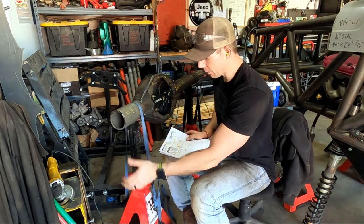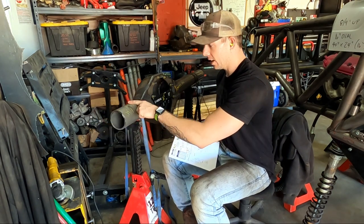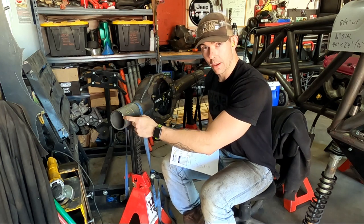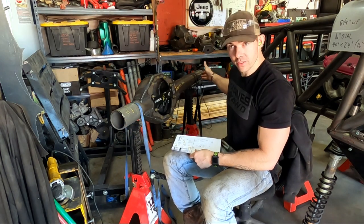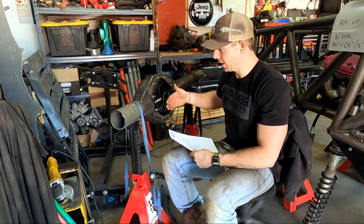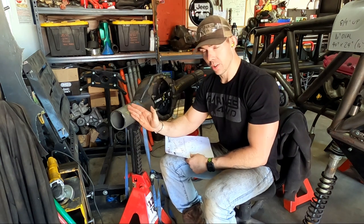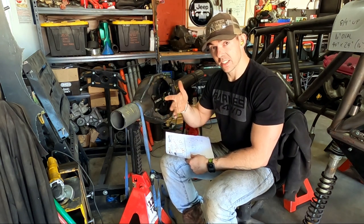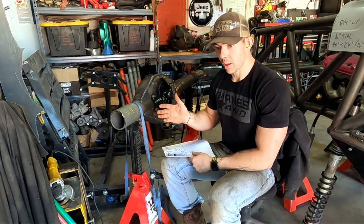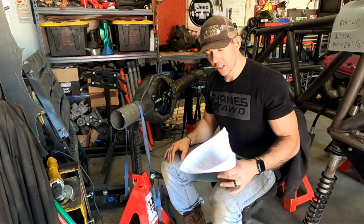I've got a three-and-an-eighth-inch gap so that whenever we press the knuckles on, there's a place to weld and the knuckle fits all the way through with an eighth-inch gap on the back side on both sides. Ideally our pinion angle will be at zero degrees, and we're going to set our knuckles at roughly six to seven degrees. That will be more beneficial off-road and help center the tires back to center.